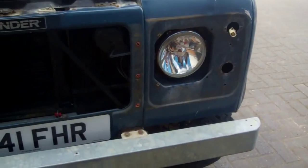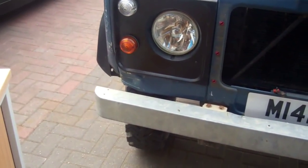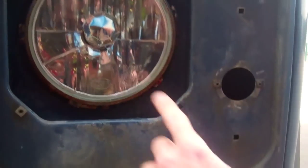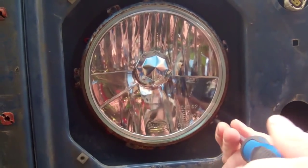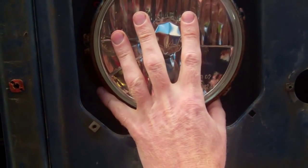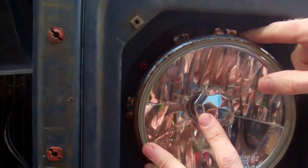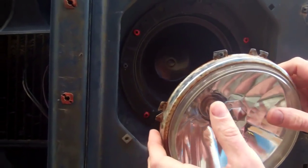We'll do the other side off camera to make the video a little bit quicker. Let me put those little screws in. Right, the next thing we need to do is remove the headlight. I've coloured these screws in orange. So there is a screw at the 5 o'clock position here, and that's the same on both headlights, isn't it, Tom? It is exactly the same. And then you've got these two slots here at the 12 and 9 o'clock positions, and you can actually undo those and then...